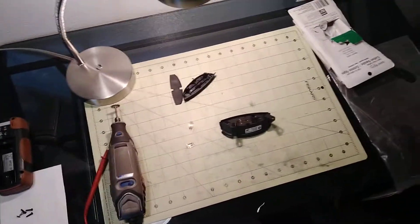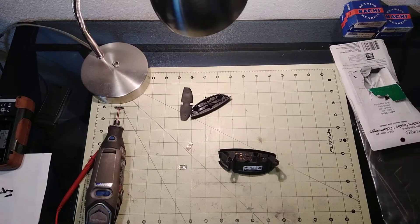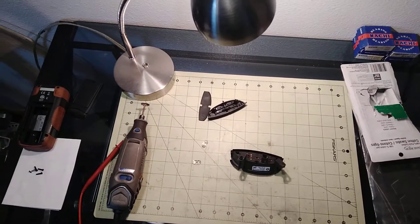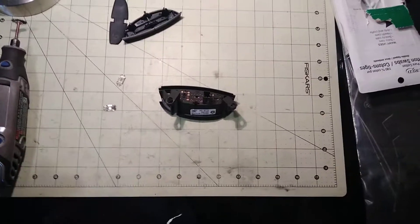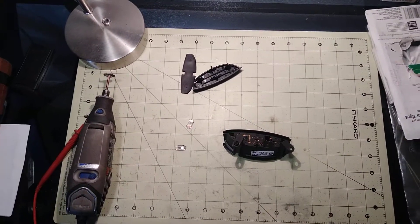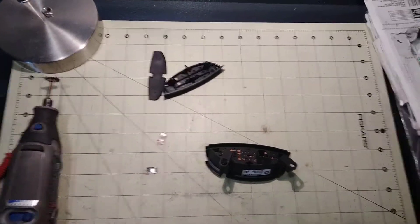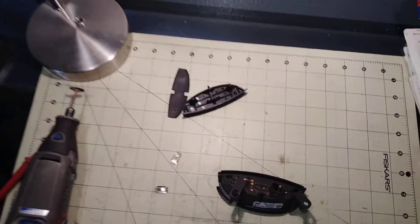I have voltage coming from the PCM down to the brake switch and then across the brake switch to — I believe it's dark blue and red, the wire right next to the red and orange. So I have power coming from the PCM to the brake switch, going down to my vacuum canister or servo, and I have a good ground there. It's just up to the vent and the dump valves. But this is mainly about cleaning the switch, making sure the gauge cluster light works, and testing for power at the clock spring. There are other videos on fixing vacuum lines and more troubleshooting. If you liked this video, subscribe if you want — I don't make a lot of videos, but if it helped you out, hit like and drop a comment and I'll try to reply. Thanks.